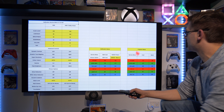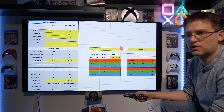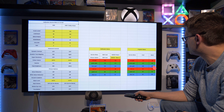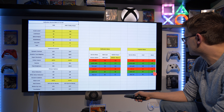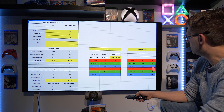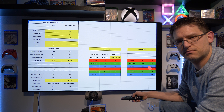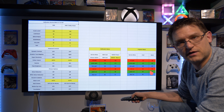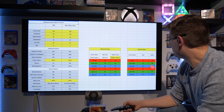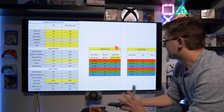Have a look at the original values and put in the comment section what you have on your LG CX 65 inch or 55 inch — but also mention what panel type you have. I'd like to know if you end up with the same values: 192, 167, 121 in warm. The green cut values are always 64 in all the color temperature settings in the service menu. I want to know if LG is doing a pre-calibration before shipping the TVs, or if they're just updating them all with the same software.